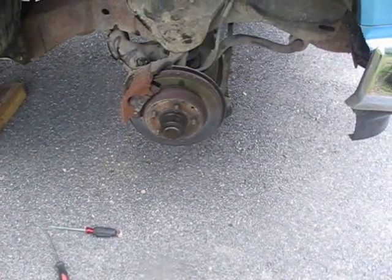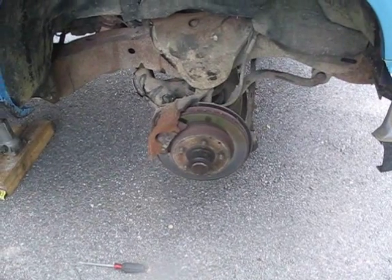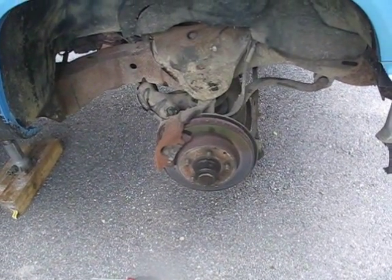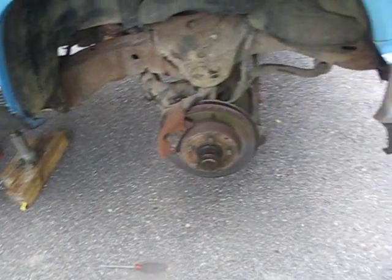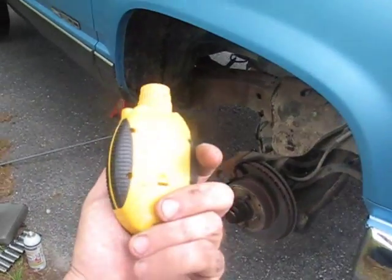I just went on a short drive and determined that this one is malfunctioning somehow, so I'm going to have to take it apart, clean it, put it back together, bleed it — do whatever has to be done to make sure it starts working well again. So that's how you can figure out which one of your brakes is not working. Fifteen bucks.